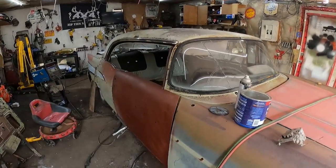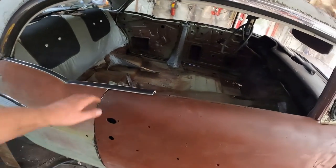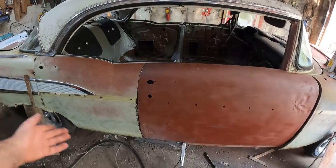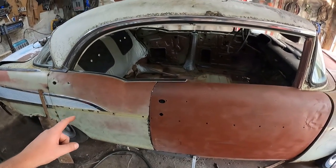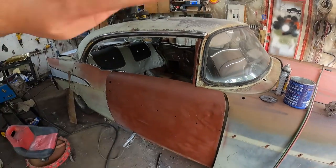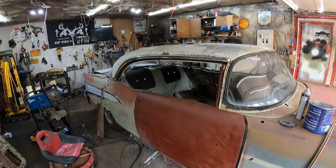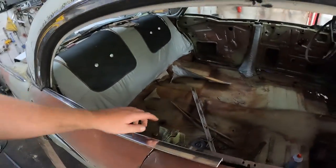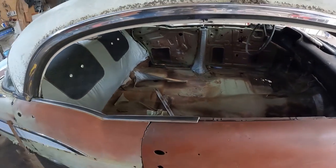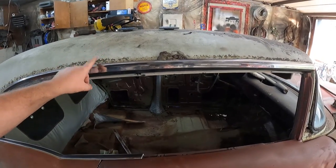Well, it's starting to make a little bit of sense to me. We've got a lot of strength with just a few little tacks — it's way better than it was. There's no rockers, there's no floors, but I think it looks pretty good. You can kind of block out the roof a little bit — looks like a convertible. I think what I'm going to do now is just start bracing things a little bit with some angle iron and box tube I have. I'm going to look at how bad that side is, because honestly I want to take the roof off. I want to see what it's going to look like and make sure I'm on the right track.